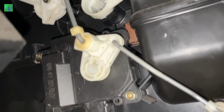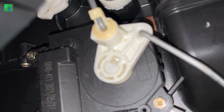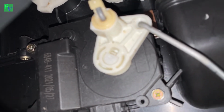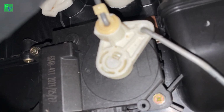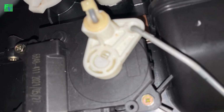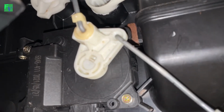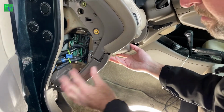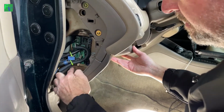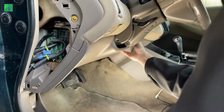By the way, the bolt there is really tough to get to. I would recommend using a small socket and wrench. A 9/32 worked, so we use that. So we're gonna put everything back together and we're calling it a day. All right, just put it back the way you had it. Line these 2 holes up, and there's little push pins that line up in there.